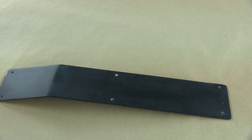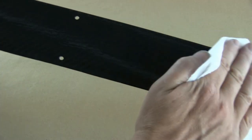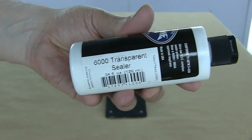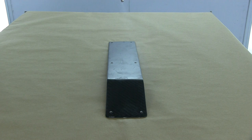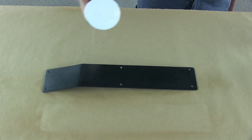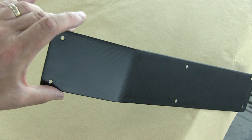Now we're going to look at carbon fiber. One thing to be aware of when painting carbon is you quite often get little pinholes - I've seen that hundreds of times; it's just the nature of carbon fiber. Get it well cleaned and degreased, then come in with Sealer 6000. I'm assuming you'd want to keep the carbon look - why else would you be painting carbon fiber? - so I'm using clear transparent sealer. Typically I'd only apply two coats over carbon, and that's really the perfect ground coat if you want to lay down a candy or go straight in with your clear.